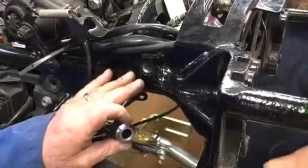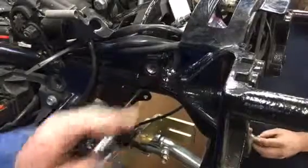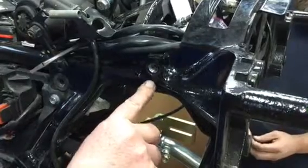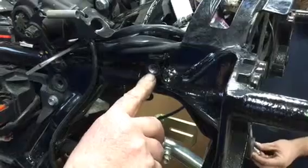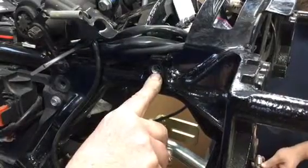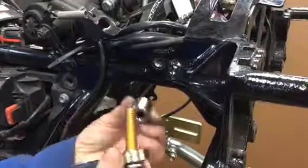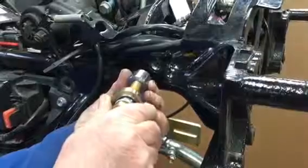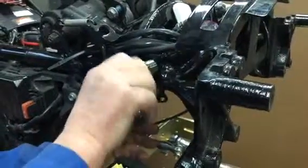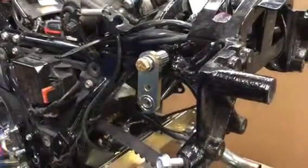Unlike the original one that we showed you for putting the top mounts on, some of the later model ones don't have the boss sticking out that has the 1/2-13 hole. It's actually a 1/4 inch hole with no threads in it. So what you'll have to do is drill that hole to 27/64 and tap it to 1/2-13. Then we would add a spacer and a 2.5 inch bolt into our hole, creating the same number that is necessary, making sure that offset hole is to the bottom.